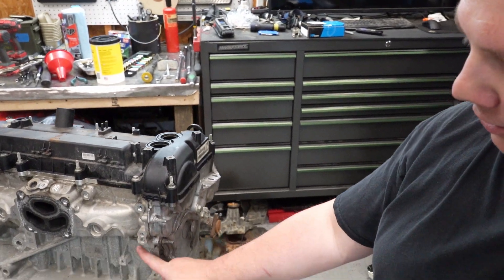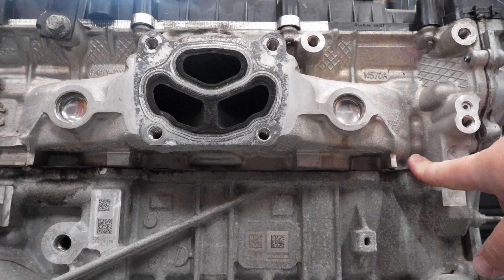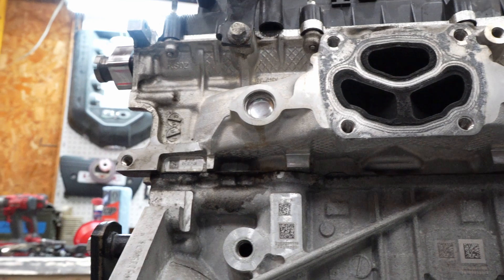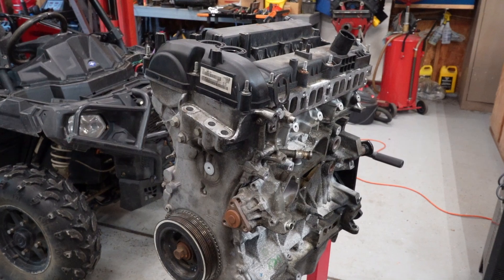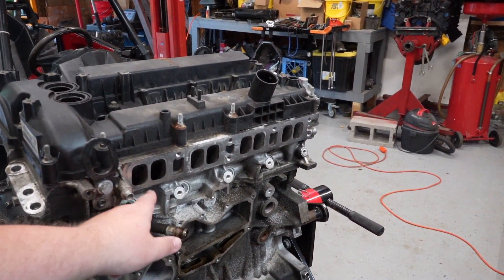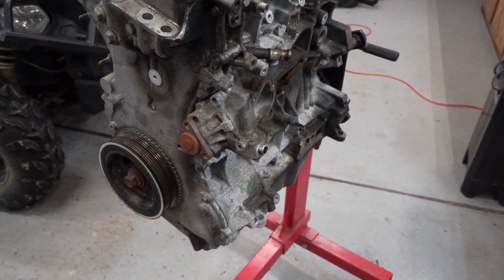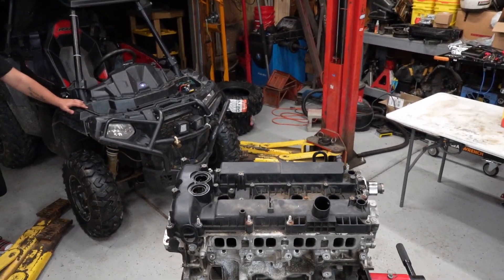Fortunately, I don't really care about all that stuff missing because the important thing when it comes to this engine is the head gasket. For the first year these engines were out, they had problems with head gaskets blowing on them. Eventually in 2017, Ford issued a big recall for all of them. In Europe, they had guys go out in vans to find every Focus RS they could and replace the head gasket. This engine was developed from the 2.3 liter Mazda engine that was in the Mazdaspeed. It had a problem with cylinder number one — that's why it was replaced under warranty.